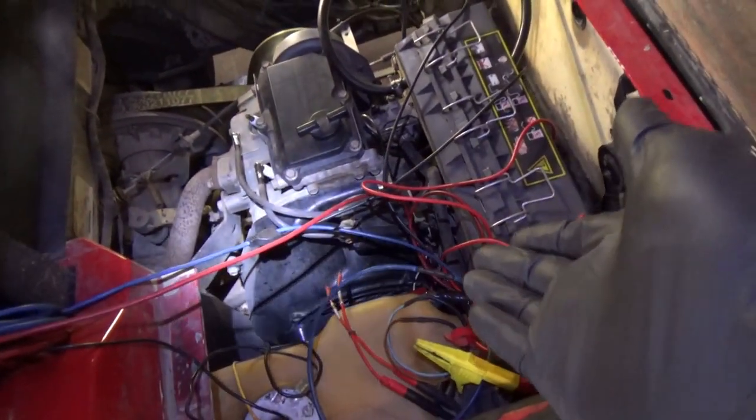We need to figure out why this power feed is weak — it can't carry the current. Voltage measurements are the key here. The ohmmeter wouldn't find this problem — if you check the power feed from the connector or the fuse you wouldn't see it. This power feed cannot carry enough current for the ignition coil to make a good spark. Crazy case study — no parts required. We have to find where that red wire comes from, and without a wiring diagram it might take a little while.